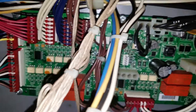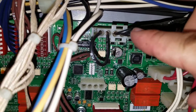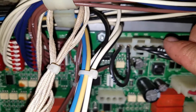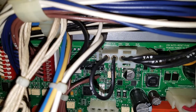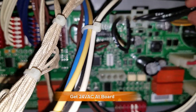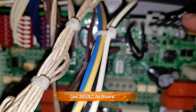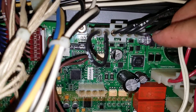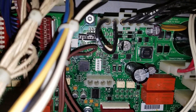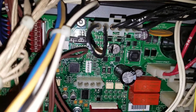To properly diagnose it: these wires here are for your selector valve — you'll see 'valve motor plus' and 'valve motor minus.' Check for voltage on those two wires. If you're getting 24 volts across that wire and the next one, you've got voltage going to the motor and the board is fine. The issue is then going to be the selector motor.